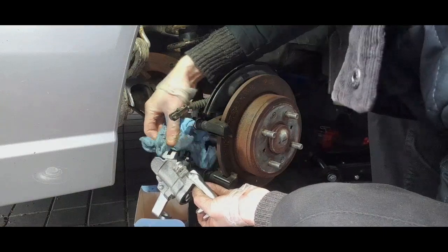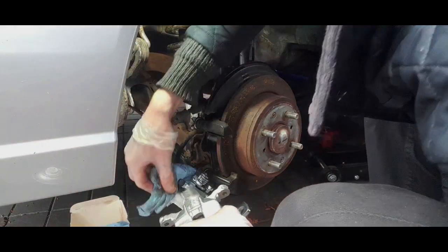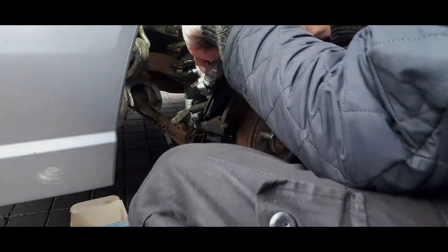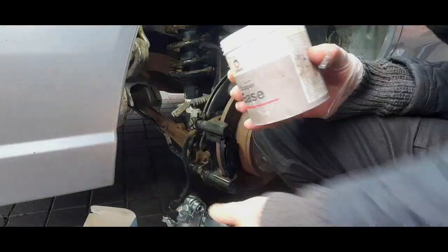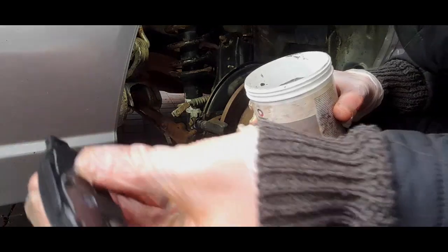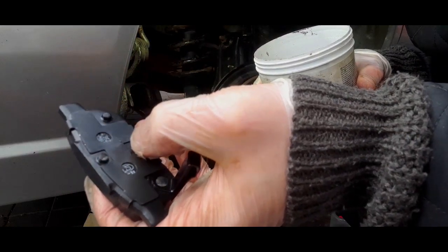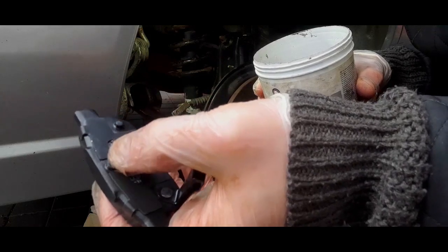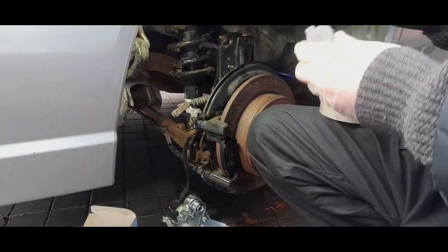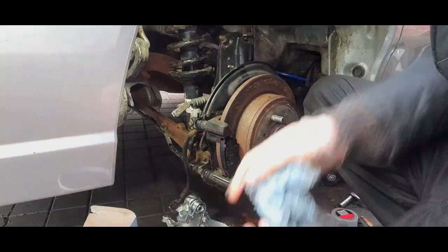I need to tighten that further when it's actually on the car. There's quite a bit of brake fluid in there - I suspect that clamp hasn't fully stopped it but it's slowed it down. One thing I forgot to mention: always put copper grease on the ears, and on the inside one make sure that the dot - this indentation - lines up with the piston, whichever cross slot it is, it just has to fit into the piston. Then you're done, just slide it on. The sliders are very keen but I'm just going to put some lube on the ears - try not to get it on the actual brake pad.